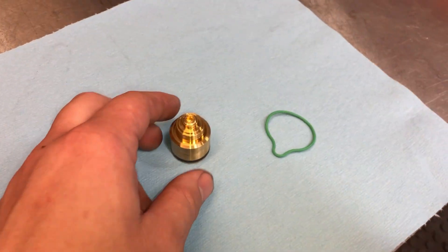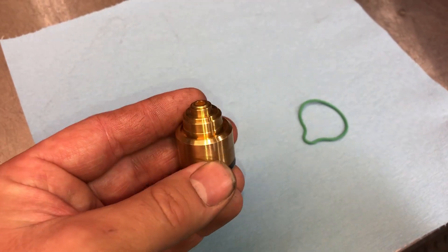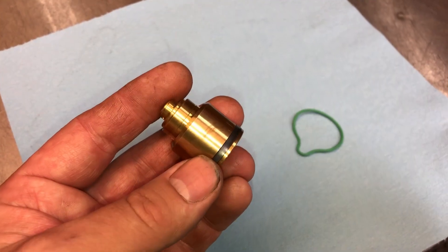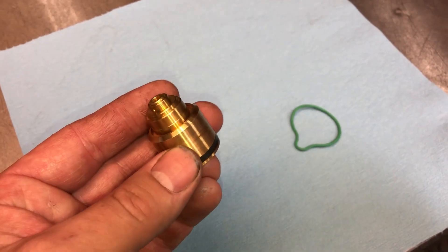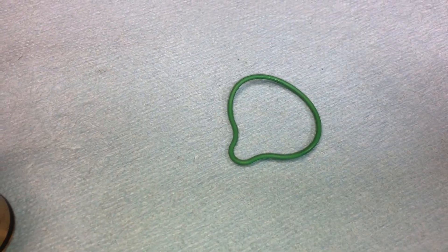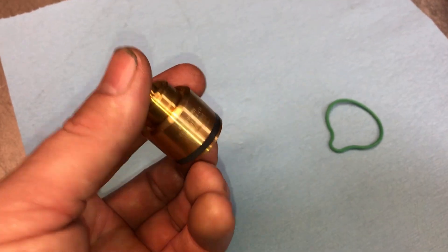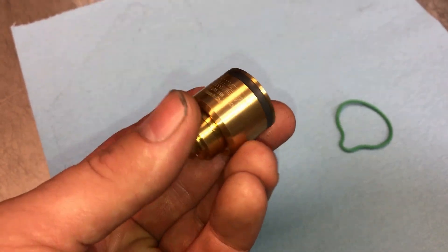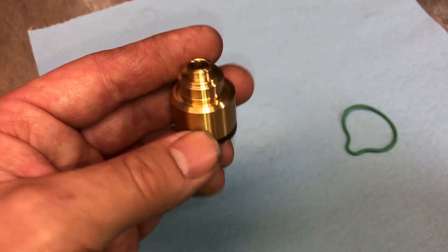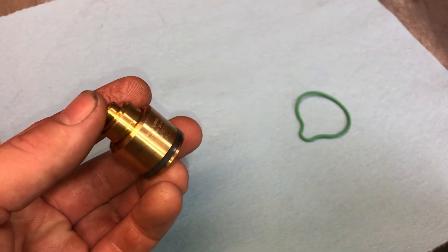This little refrigerant control valve is what's causing all your poor AC cooling at idle. It's mechanical, pressure and temperature sensitive, and over time it can get stuck and bind. The good news is you can buy these separately from the aftermarket — pre-assembled, adjusted, with a new o-ring and housing plate gasket. The Dorman one is about $35 and has proven to be reliable. This one was made by Gudeal and looks exactly the same. Either way, $35 all inclusive, good to go.